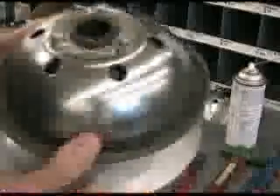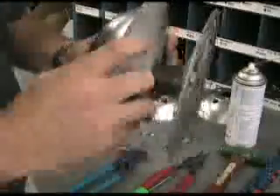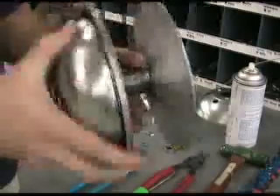To go over what the main component of the CVT transmission is, we look at the drive clutch. The drive clutch is directly connected to the engine output shaft through this hole here. This drive clutch is directly connected to the motor speed — it's always spinning. When your engine is on, this is spinning the same speed as the motor.